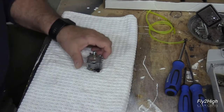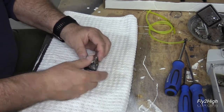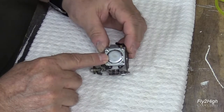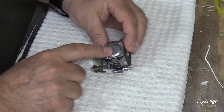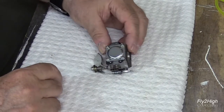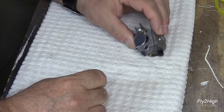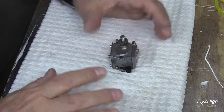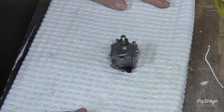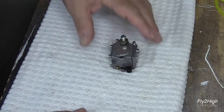Well, it is another day. I did some looking on the internet and found that a diaphragm that went under this cover was installed improperly, so I've already taken this apart, moved the diaphragm to the proper position, and reinstalled it. So the carburetor should be correctly — at least partially — rebuilt, and I'm now ready to start putting this back together. The plan is to get it together enough so I can put some fuel in it and see if I can get it to at least try to start.